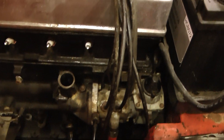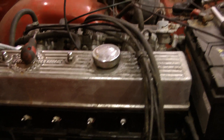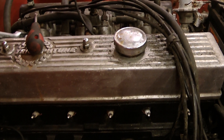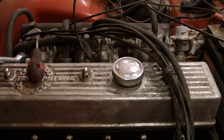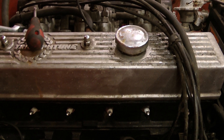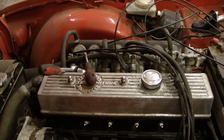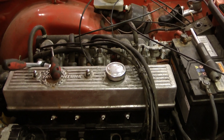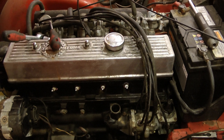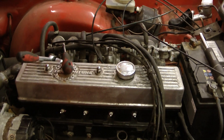That side of things is like a standard diesel motor really - like an old school mechanical diesel system. And there's your injectors over there, spray onto the back of the valves. And believe it or not, this is actually kind of more advanced than KJetronic, in that it's really early sequential fuel injection - it fires in time with the engine. Whereas KJetronic fires all the time, it just runs continuously, spraying a quarter of the amount of fuel that's needed onto the back of the valve per stroke. By the time the valve opens, that charge is ready and drawn in. Whereas this actually fires as the valve opens - which is pretty impressive really for 1960s technology.